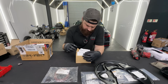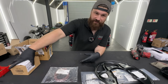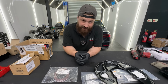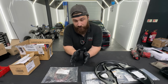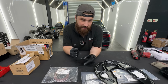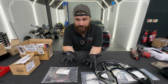I didn't want to risk it to go with some kind of aftermarket stuff because I don't want to damage, for, let's say, 200 quid of saving, a disc which is 5 grand. So I rather stick with the genuine stuff, and I make sure that the discs what I bought with calipers and everything will stay in a good shape for as long as possible. Of course, I did check the discs. We still have enough weight. The thickness is quite far away from the minimum thickness, and I don't see any damage on them, so I did check them, and so far I'm happy with them.